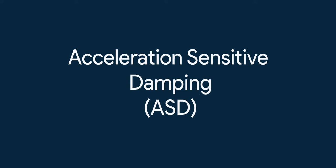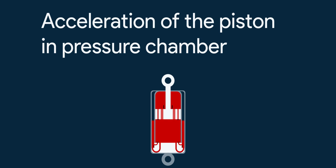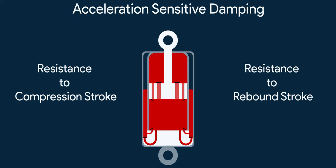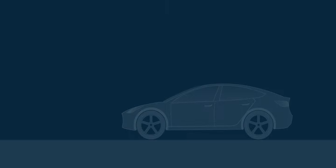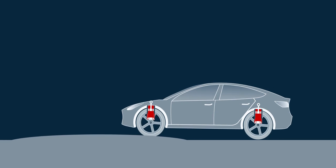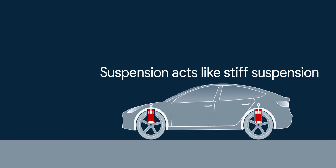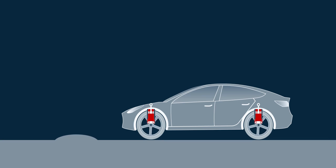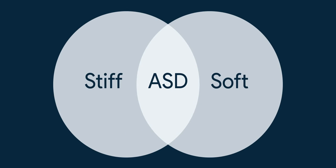Next is ASD, meaning acceleration sensitive damping. Acceleration here refers to the acceleration of the piston in the pressure chamber, not to the acceleration of the vehicle. ASD offers resistance to compression as well as rebound, while resistance to compression becomes lower when the piston accelerates faster. When a vehicle approaches a bump or pothole slowly, the piston doesn't accelerate fast enough, so compression remains resistant, giving stiff character to the suspension and better handling to the car. For any instant and heavy shocks, when the piston accelerates faster, the compression stroke becomes very less resistant, so the piston travel becomes quicker and easier, absorbing the shock better and offering a comfortable ride. So an ASD has stiff as well as soft character when required.